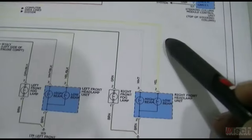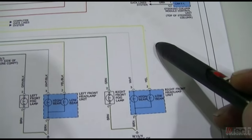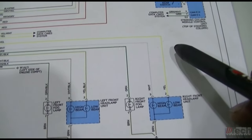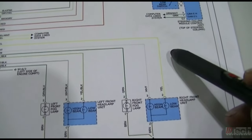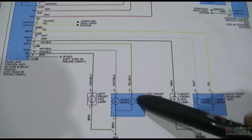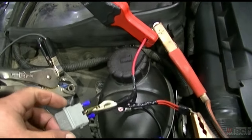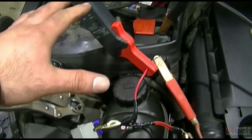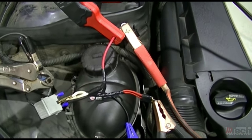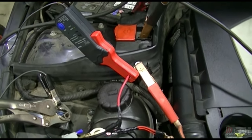So the other idea was to use this feed on the control side of a relay, since the relay control sides take very, very little amperage, and then on the other side of the relay to provide power to this headlamp. And so this is basically what I've got set up, and I'm also doing some testing measurements to watch the whole system and make sure that everything is okay and operating within good levels.